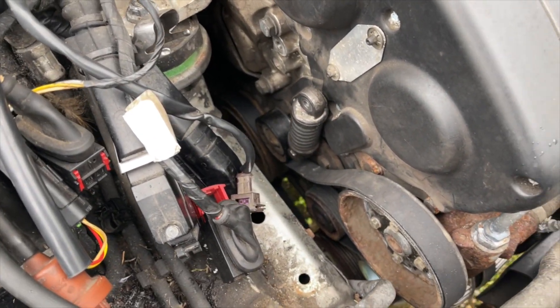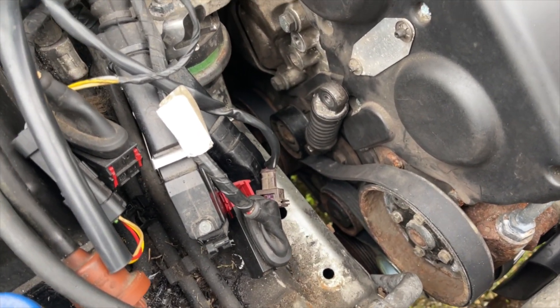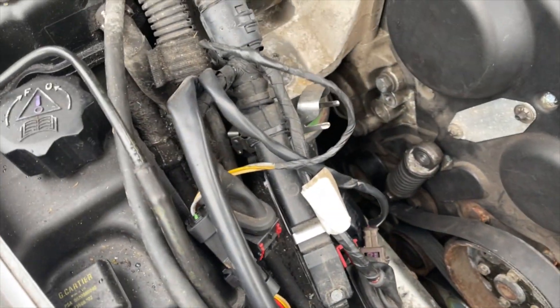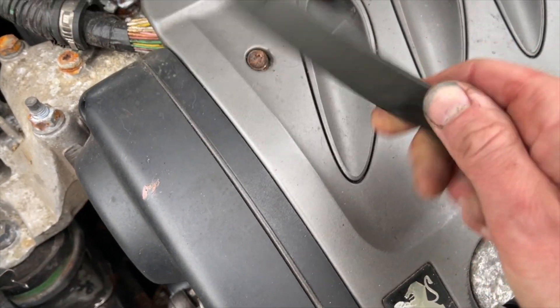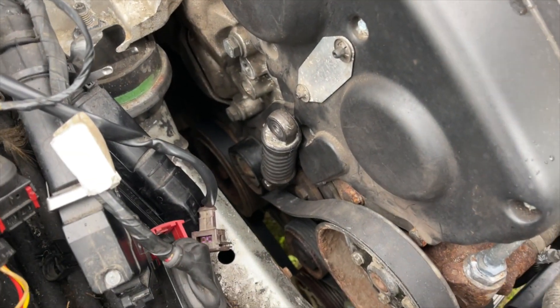There was a slight delay because I had to order a new belt. Three belt sizes came up on Autodoc and I'm sure proper YouTubers would know instantly which to get, but because there were three different sizes I took the old one off first and realised I needed the 1600. The old belt wasn't actually too bad — there were some slight bits of wear — but it made sense to replace it while I was in there.